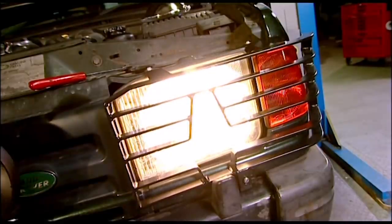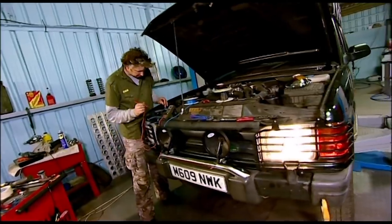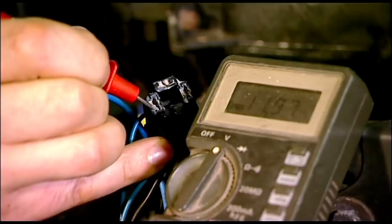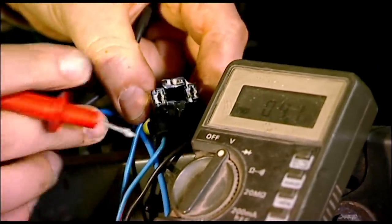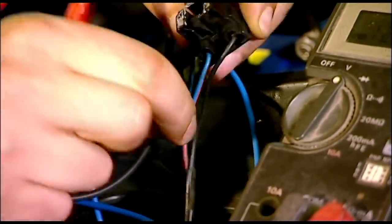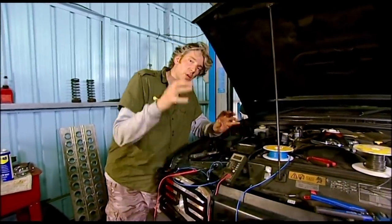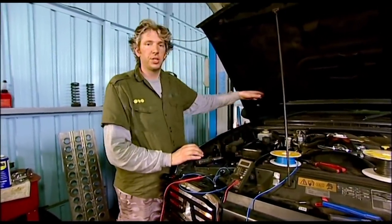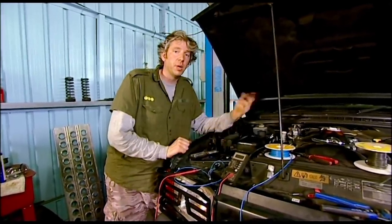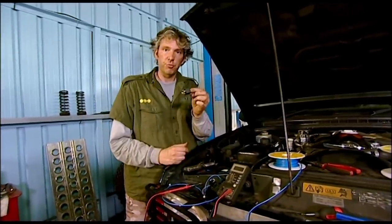I've now done the earth so I'm now looking at the positive side of the circuit. I've turned the lights on, put it on high beam, and pulled off the connector that goes onto the back of the light bulb on this side — 12 volts. That is this terminal here, which is the blue wire with the red tracer. The reason I need to find that is because I want to turn these lights on and off with the high beam. So rather than having a switch in the dashboard, which means running wires in there and drilling a hole, I'm going to simply use the high beam the car already has. I'm going to take a signal off that to actually switch a relay.